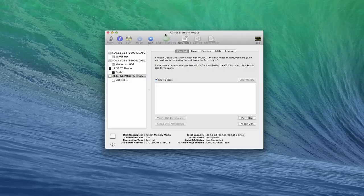So here we are in Disk Utility and you can see I've got my USB stick over here. I don't need all of this space on this USB stick to have the installer run. It's usually recommended somewhere around eight gigabytes — I think the installer itself is like five and a half or so, so somewhere in that seven to eight gigabyte zone. So I need to partition this USB stick.